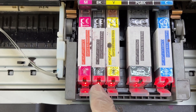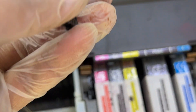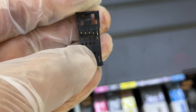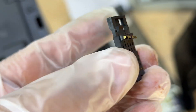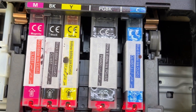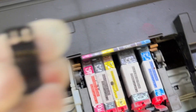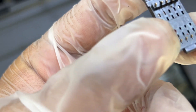All connectors are working fine now. Before, the black one was not working. As I mentioned earlier, the issue was from this connector — the pin got damaged. I got a scrap part from another printer, moved this part from my old printer, fixed it here, and now all things are detecting perfectly. This was the method for fixing a cartridge connector that is not working.